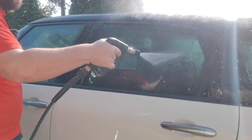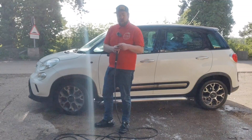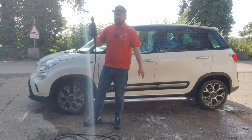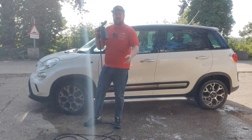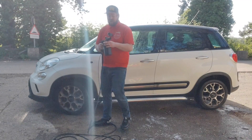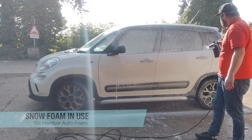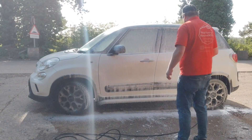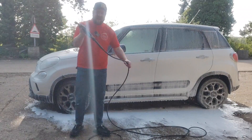You can now rinse the car off with absolute ease, then pop your nozzle off and put your snow foam cannon on. This is the old hose from my Bosch straight into the Yard Force machine, into my AutoBrite Direct gun — and now I can snow foam my vehicle straight from the Yard Force through this hose with absolute ease. One important thing to remember: if you're upgrading from a 110 bar pressure washer with 1.1 mm orifices in your snow foam cannon, make sure you change them to 1.25 mm. At 135 bar, a 1.1 mm orifice will labour the motor and burn it out quicker.